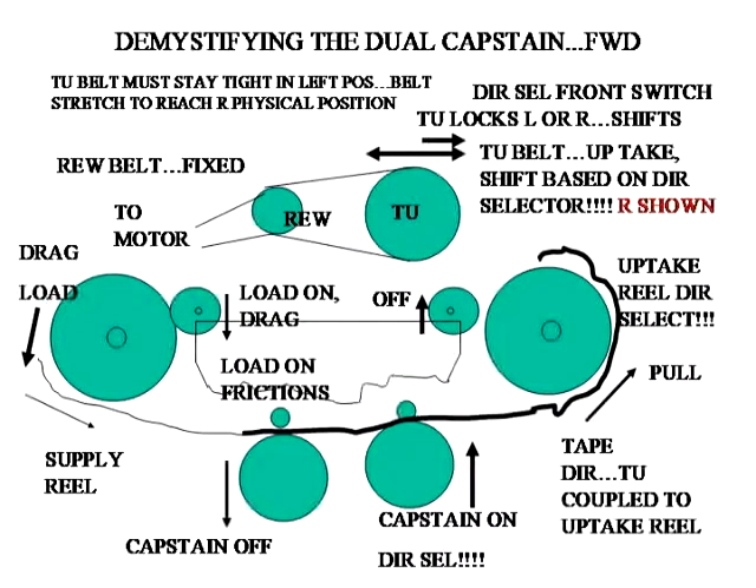This is the key part of the presentation. There are several diagrams like this. If you understand what take-up and supply reel are, you might be able to skip some of the slides. If you want more discussion, I have many text slides in this presentation. Here it is shown in what we call the forward mode or the right capstan mode, and the TU wheel is in its right position. The TU wheel slides laterally back and forth, and that is very key to understanding this.